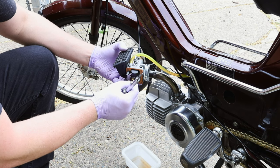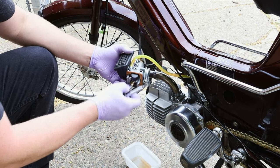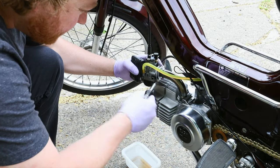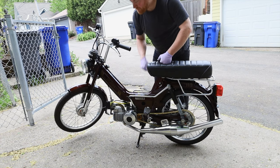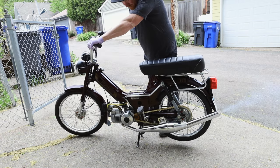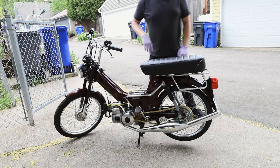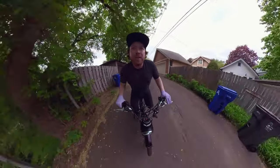I had a 79 main which I felt was a little lean, so I'm actually going to put in an 85 — I think that might be a little too rich but it'll be a good starting point. Turn on your gas and let's see how this runs. It seems a lot better. I'm going to take it for a test spin and see how it does on the road.